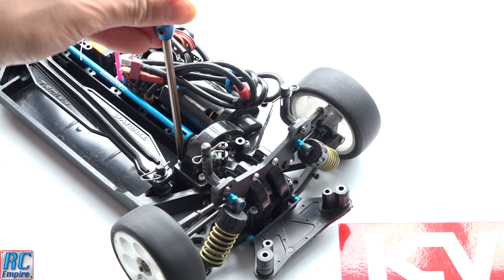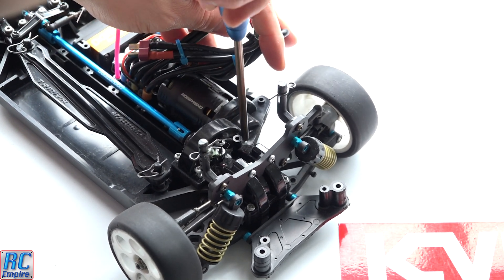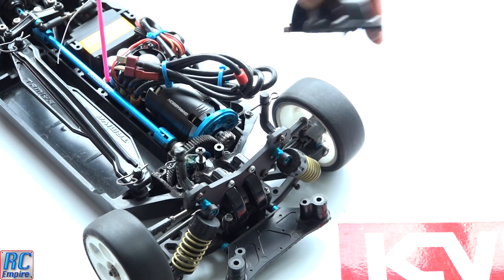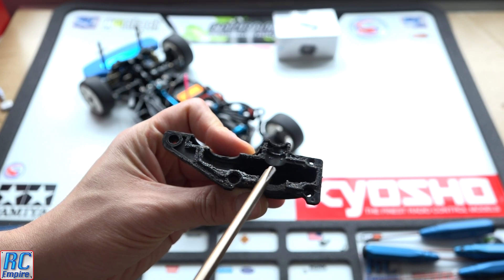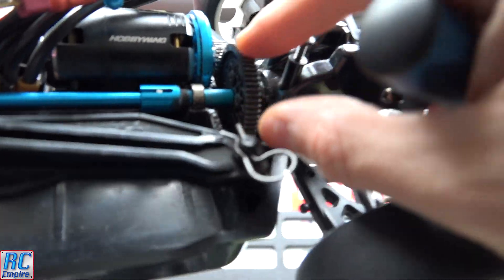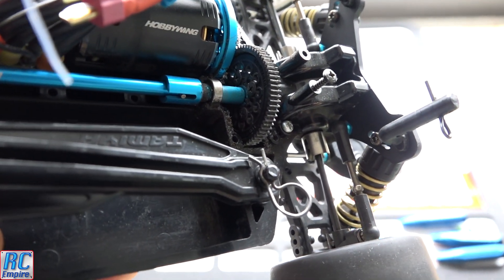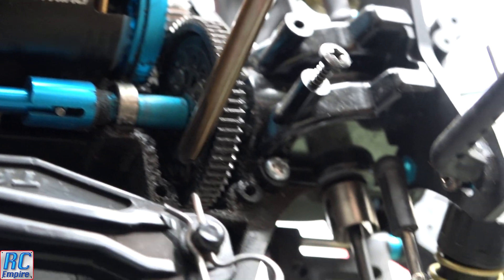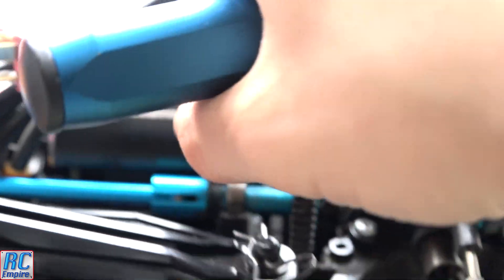The first step is to remove the motor. On the TT02 this is super easy — remove the top plate and that will expose the pinion and spur gears. One thing worth noting is just how much grit and rubbish gets inside here. Even when the screw hole wasn't stripped, stones still got in and got stuck in the gears. We even sealed the top with a layer of heavy grease, but they still get in — so it's worth opening that up every run or every few runs and blowing and brushing out any grit or dirt.